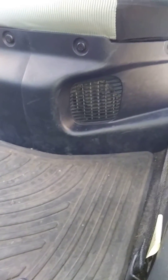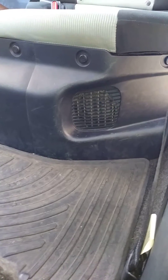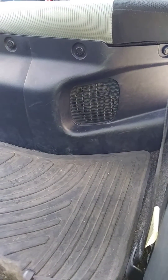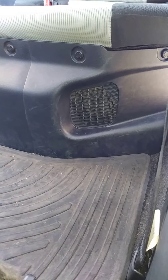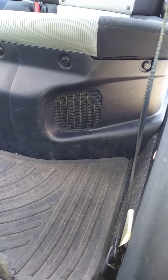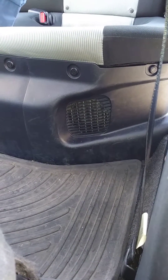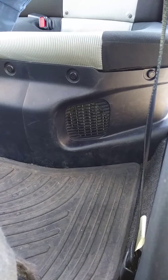Hello again there YouTubers. We're in a 2016 Toyota Prius C looking at the battery cooling fan grill. By about 20,000 miles, from the inferior carpet fibers and seat fibers chosen by Toyota for this car, you will have so much lint built up on this fan grill there will be an error message appearing stating that your battery is overheating and that you must proceed immediately to the dealer.